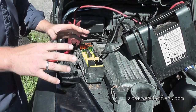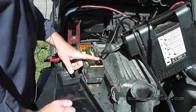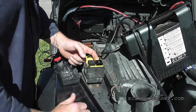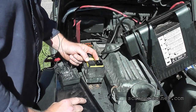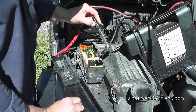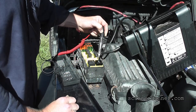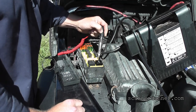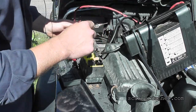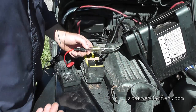Some known goods, known bads from the relay out — we're fine. Nothing wrong with the circuit at all. Nothing wrong with the park neutral switch either. I'm missing control, but we already knew that. Why couldn't I do that from the front? All I was doing with that yellow wire going to battery positive is the same thing I did right here — access that pin and energize the relay, crank the starter. I have an open between the ignition switch and here.